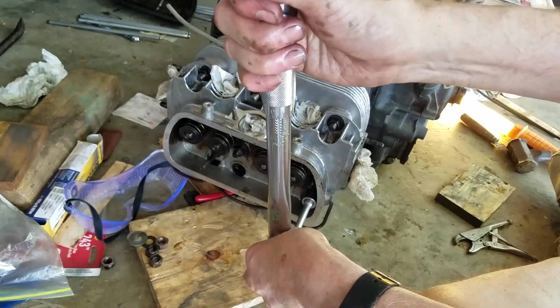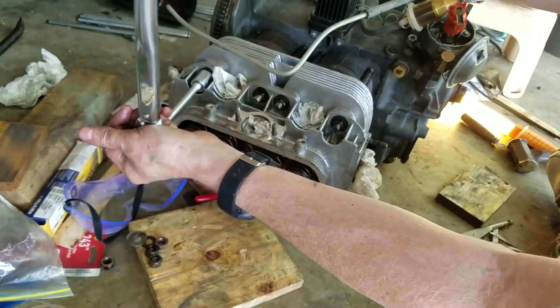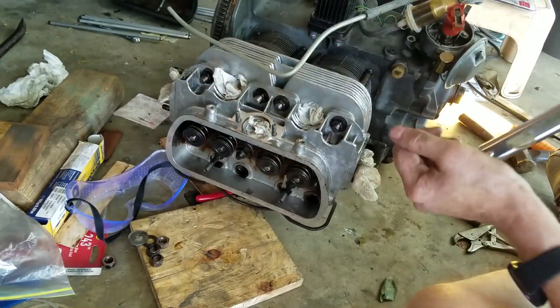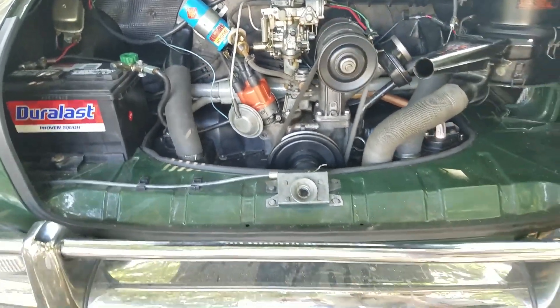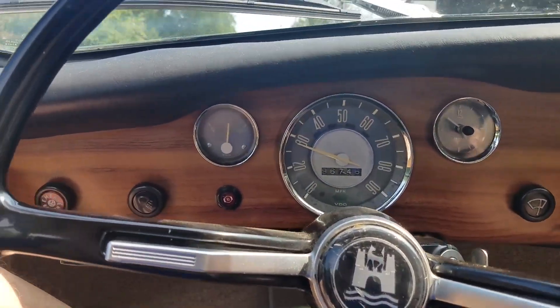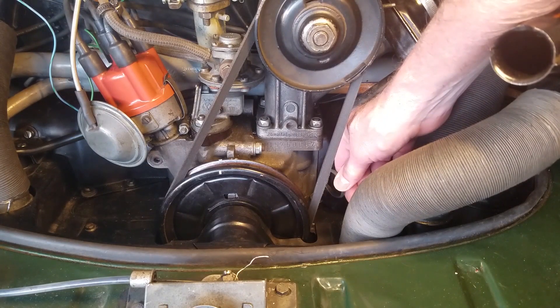While reassembling the engine, I notice that the intake manifold gaskets are missing — this contributes to the engine running lean and hot. I ordered a gasket set and installed new intake manifold gaskets. After several days of work, I started up the engine and it ran very well. I took it out for a long drive on the freeway, and when I got home, I could hold the dipstick forever without it hurting — it was just a little warmer than the ambient air temperature. Success!